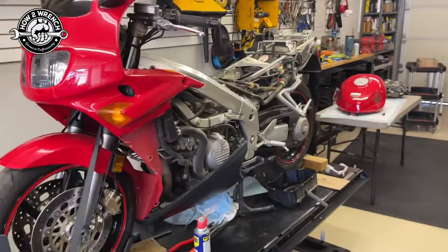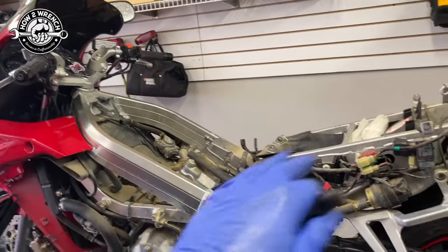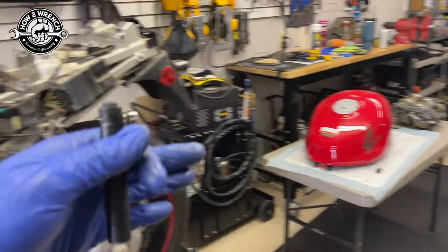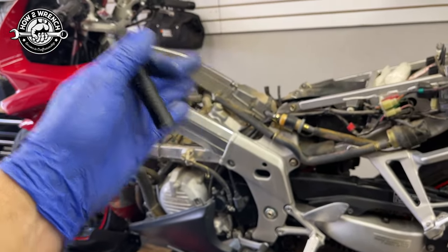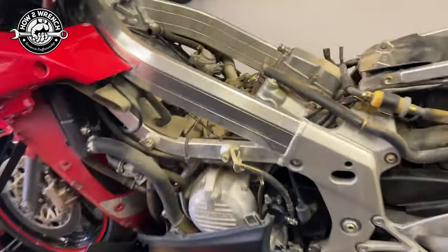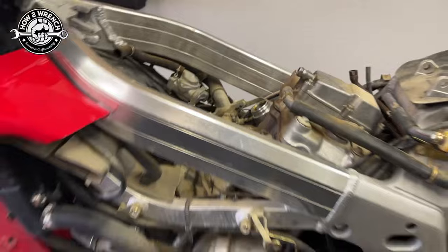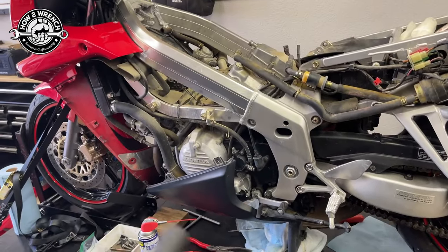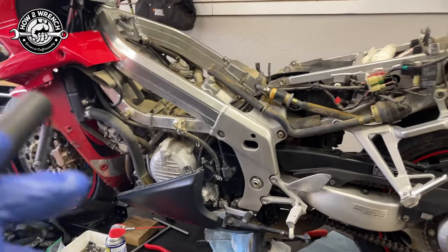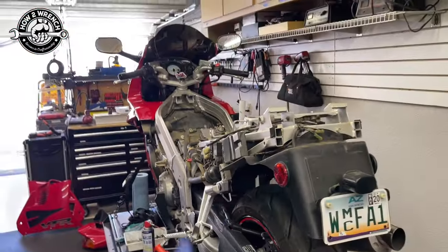I'm going to get back at it. I thought you'd appreciate thinking about that whole process — from the fuel tank to the pump to the carburetors. Where did it go? What happened? We have our evidence. There's always a chance it was overfilled with oil in the past, but based on our evidence going down the intakes and our overfilled crankcase, I think we've got fuel in that crankcase and we've got a little more work to do to make this right. As always, make sure to like, share, and subscribe. Make it a great day and keep wrenching.